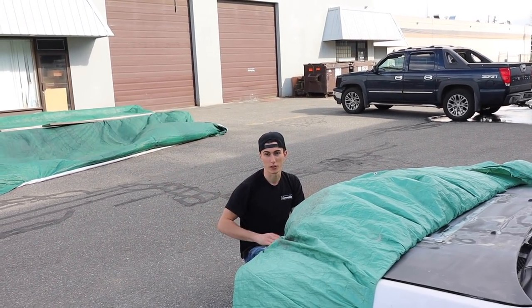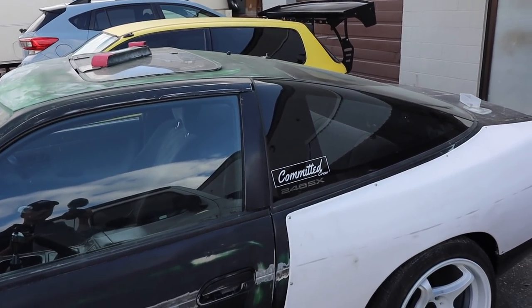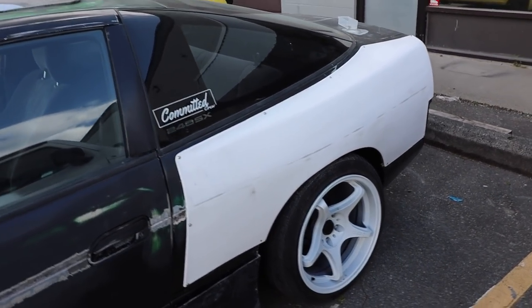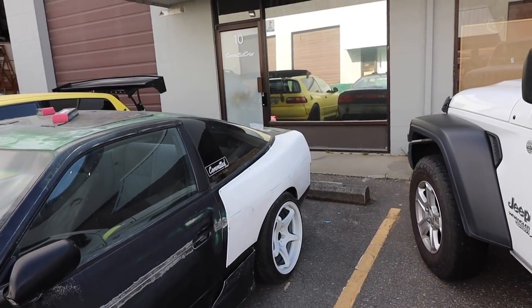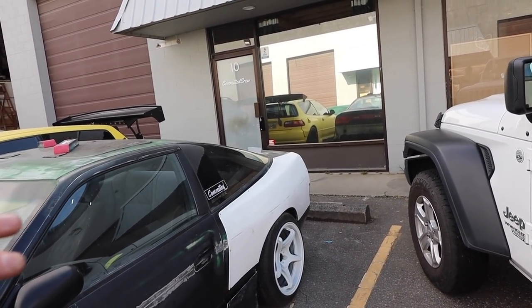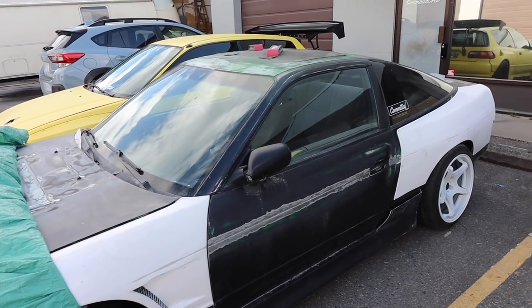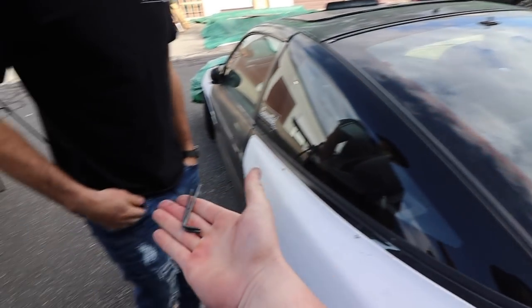Yeah, because when I dipped my car, I dipped it with them off, and you could easily tell maybe the spray pattern was slightly different, especially because I'm doing a pearl. So we're going to do a couple coats with them off so you can never see any imperfections, just in case it shifts, like Robbie said. But then we're gonna do the final couple coats with them on, so when you do spray patterns, it all looks the same.